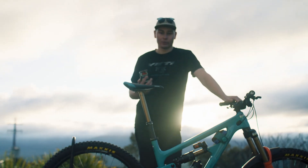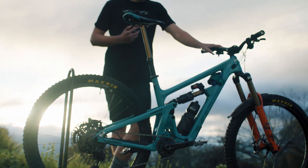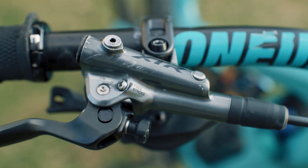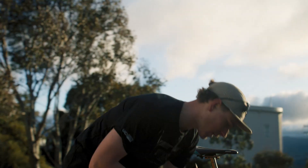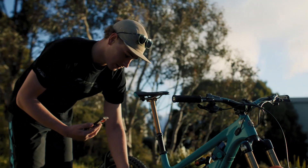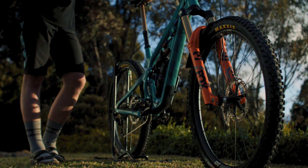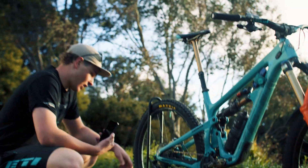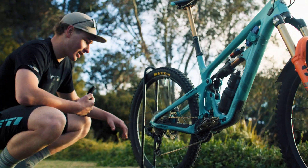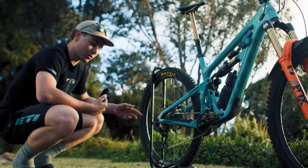Next up would have to be the Shimano componentry. We've got a bit of a blend between XT and XTR — just throughout the season, you know, bending stuff, wearing stuff out, usual wear. Nothing major has happened at all. Shimano Saint pedals, obviously opting for the biggest platform. I actually have the pins fully out and the cleats as tight as you can go — I've wound them all the way in, because there is nothing squirrelier than clipping out when you don't want to. Another interesting bit about the setup is I run a short cage derailleur. Once you go short cage, I honestly think you can't go back — just a lot less stressed about hitting it on rocks.